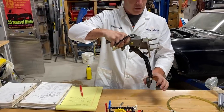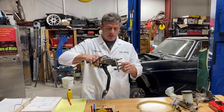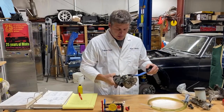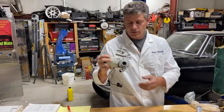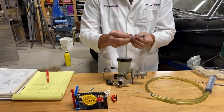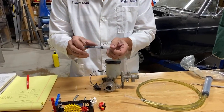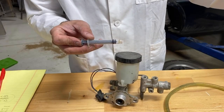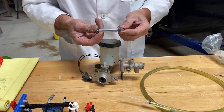That one inch of travel has six times the force — it multiplies your input by six. On an actual brake pedal it's 4-to-1 or 4.1-to-1, but the same concept applies. So there's our lever. Next is our master cylinder. Inside it has a push rod that pushes in — that's the thing sticking out of the pedal — and a piston that moves back and forth. When you push the push rod, the piston moves forward and pressurizes the fluid.